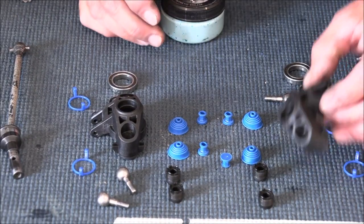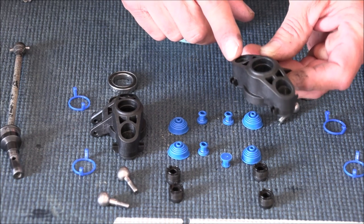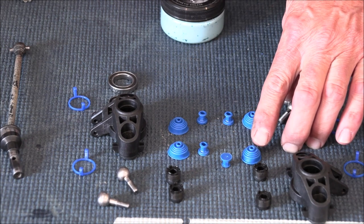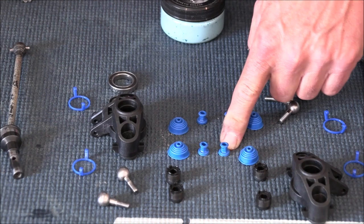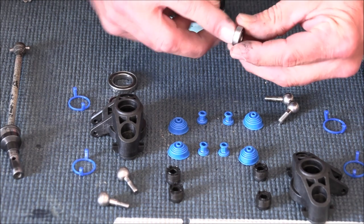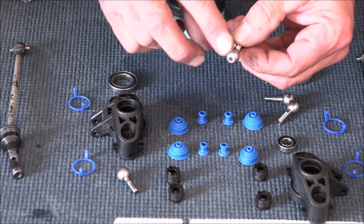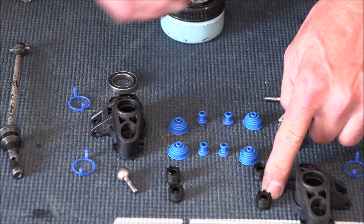I'm going to clean everything up really good and inspect it. On my steering knuckle housings, looking down inside where the pivot ball goes, it was kind of worn out, so I went ahead and replaced them. I think it's really smart to replace these retainers for the pivot balls as well so it rides in there nicely. My dust covers were pretty much destroyed so I'm using new ones from the kit. I had one bearing bad, so I replaced that. For the axle shaft, the bearing on top is the only thing holding the pin in; once you take the bearing off you can push the pin back out with a pick and the axle shaft comes off. Clean it all, lube it, and put it back together.